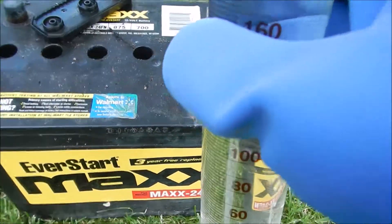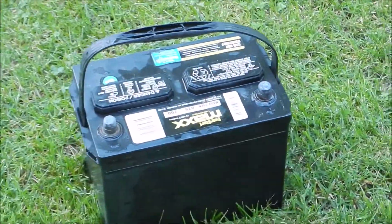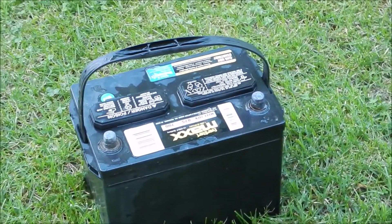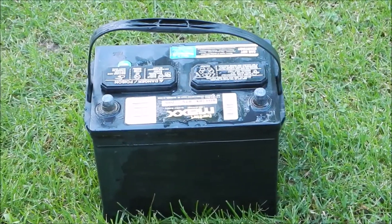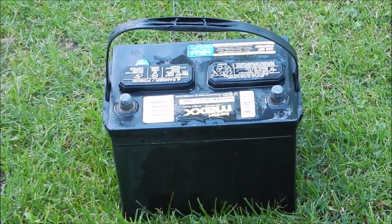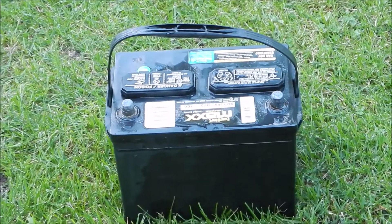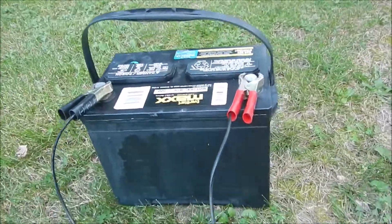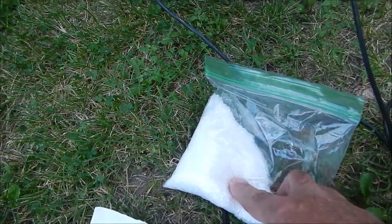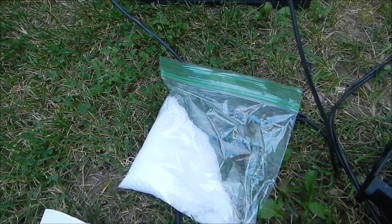I'm going to go ahead and do the rest of this. I'm not really expecting anything to happen with this battery — I think there's internal damage and desulfation isn't the issue, but I've tried to charge it a couple of times and it won't take a charge. I'm moderately impressed with this substance. I added an ounce to one cup of distilled water at 150 degrees Fahrenheit, dissolved it fully, and added it equally amongst the six cells after pulling the caps.